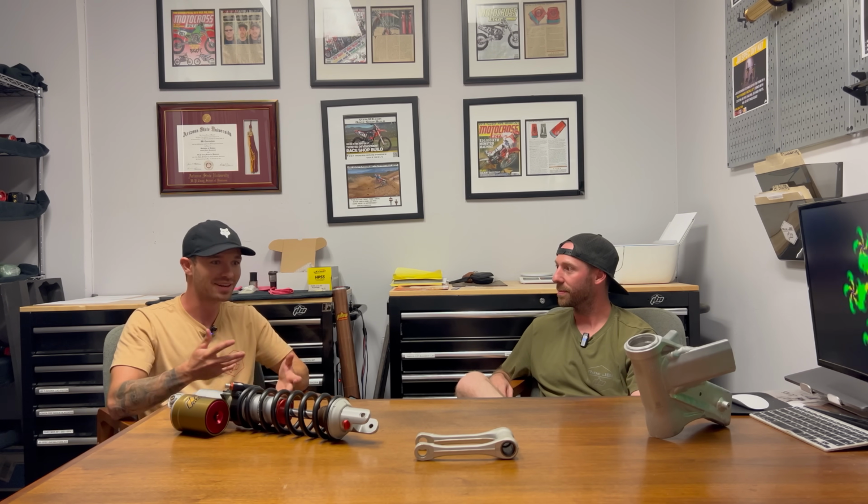Have you ever forgot to check your tire pressure? Like say you just did your tires, so you got new tires on your bike, but you didn't air it down. Maybe it's at like 20 PSI. And you ever gone riding and noticed how stiff your suspension feels? All the time. Yeah, it's a common mistake. Sometimes, I have an air fork on my gas. I would check the air pressure and I'm like, well, why is it off? That's essentially your spring rate, so it should be pretty bang on the money every single time you ride.